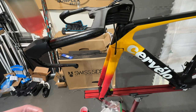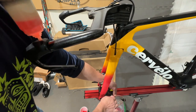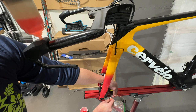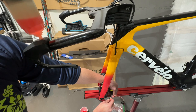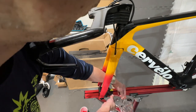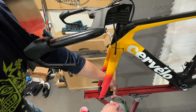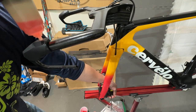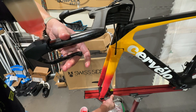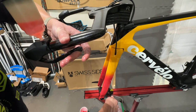According to the instructions, I should initially open up the bleed nut here and let the air bubbles come out naturally. I do see that the oil is flowing down, even though it's super slow. Just drain this out. And then I would just... This is the part that's hard to do. So basically I should depress, quickly loosen up and tighten the bleed nut. Okay.